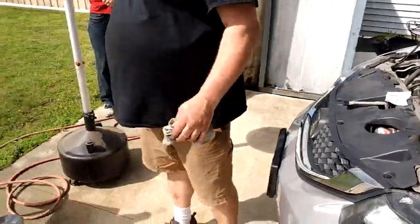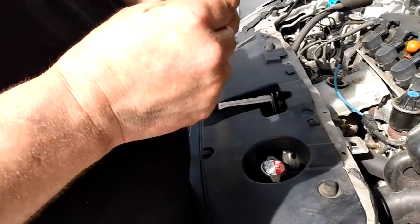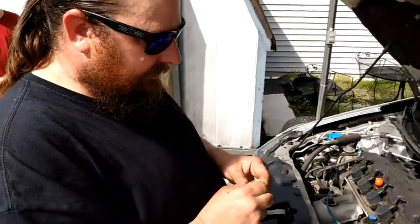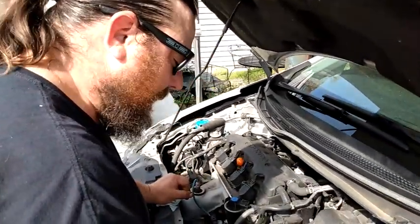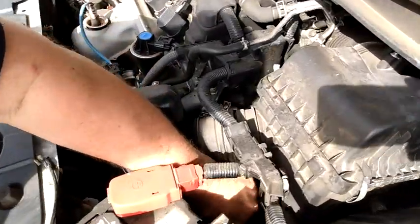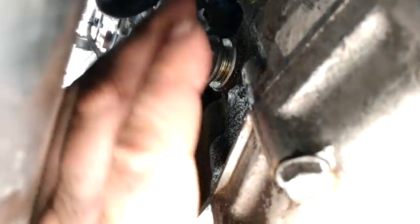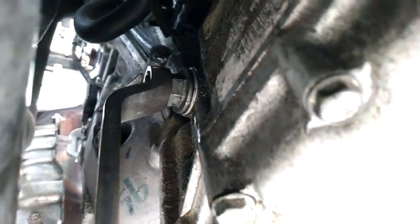Dipstick tube cap — this is not what you read it with. The bolt is what we just did: taking the bolt out and letting it run, letting the hot fluid escape from where the bolt was. This is just for filling purposes only. When it's full and running, it will come right out the side right here, so you want to try to get your hand in there and get it capped off as soon as you can. Try not to get yourself with the hot fluid.